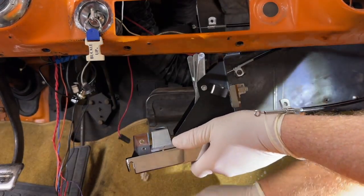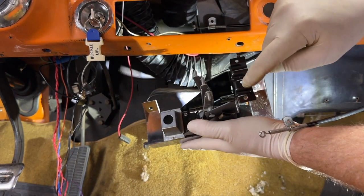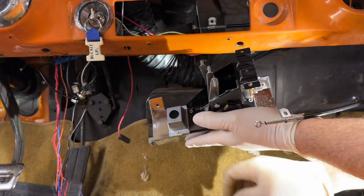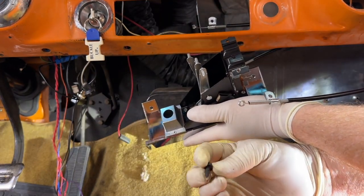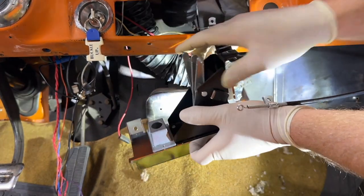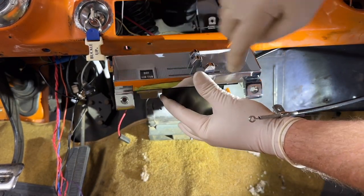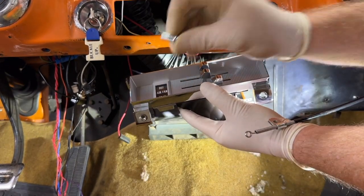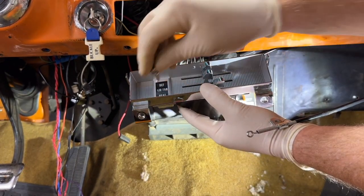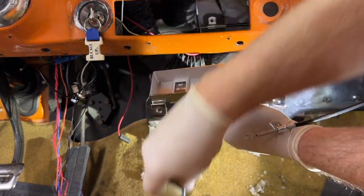Oh, the new one I bought, by the way, these are not tapped, but the screws are self-tapping. But you should just know that you've got to put some oomph into it. Oh, and these are not tapped, and the screws are not self-tapping. So luckily I discovered that, because I thought it was the wrong size. So you run a tap in there to tap those.